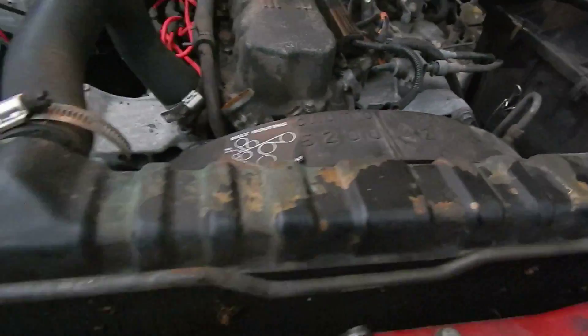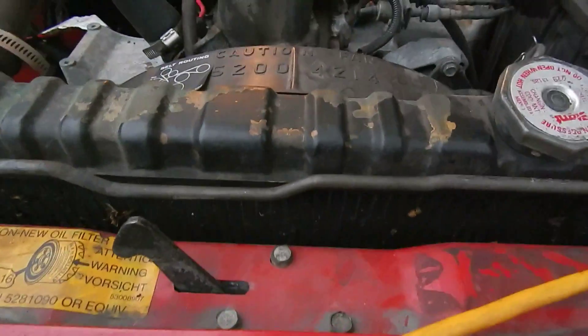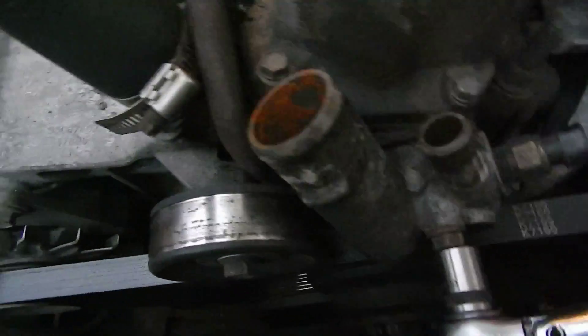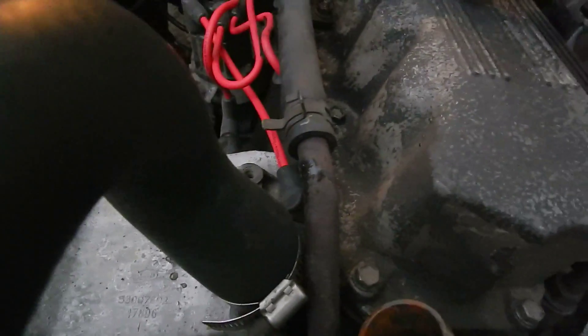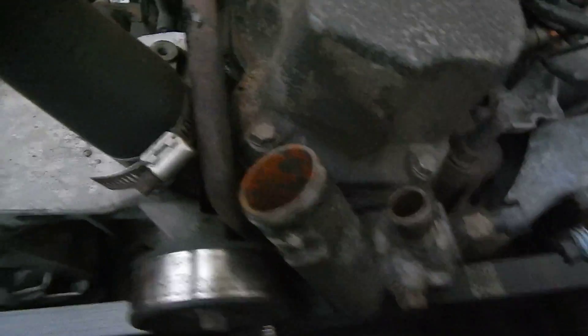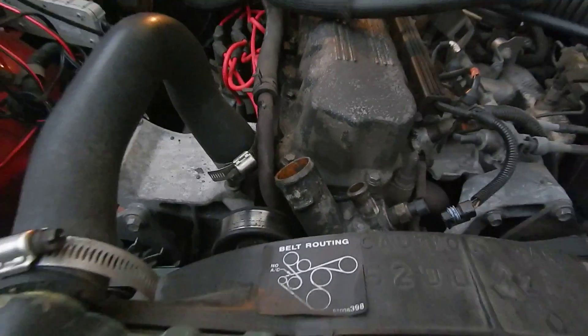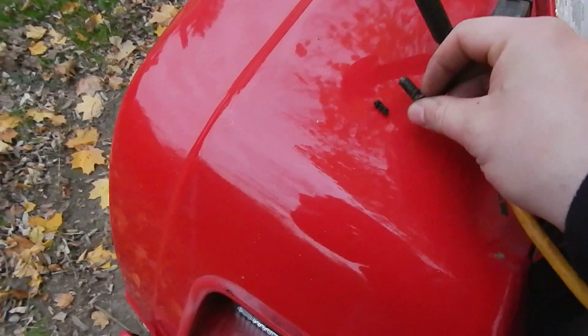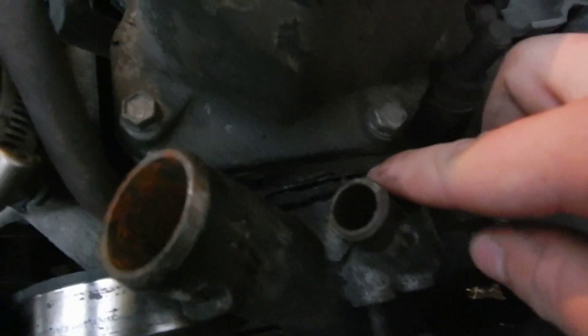What we're going to do now is take out these bolts. I already know the sizes — I did this job on an '88 Wrangler a couple days ago. It's a half inch, and I have a bolt right here, right there, and then one that's kind of down there — I'll need to use a little extension on it. So I already pulled one bolt out and you can see that there was actually some silicone that I don't like using on thermostats attached to it. They used way too much — you can see this bead of silicone back there.